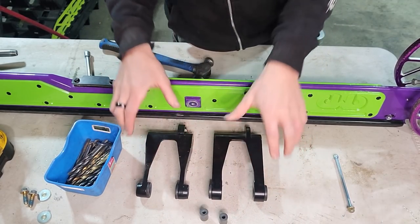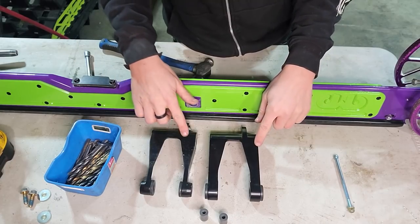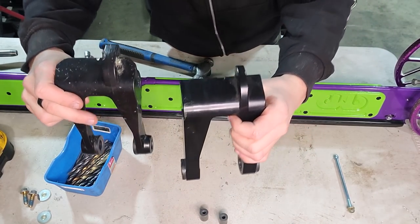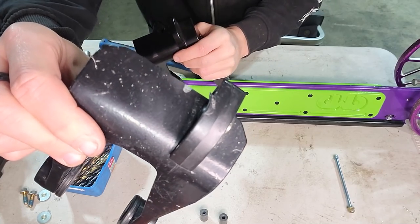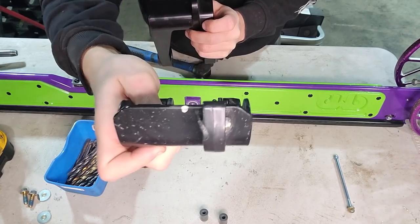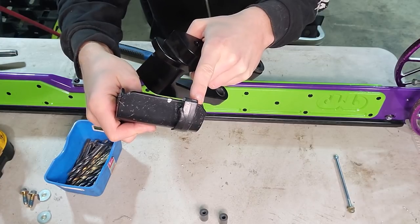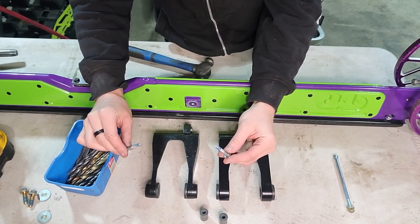Let's take a look at these two mounts and see how they're different. We have two scissor mounts — the upgraded one on the right and the stock one on the left. Right away side by side you can see quite a bit more meat on these joints. Oh, these bushings are pressed in backwards — I'll get that fixed, those bushings should be on the inside. Yeah, quite a bit more of a beefy part. That guide on the top is replaced with a cast guide, which is fine. You can see this one has already taken a few hits from a fully compressed suspension and track deflection. I've seen these break off a number of times — even break off that whole tab that screws this little pad to the mount.